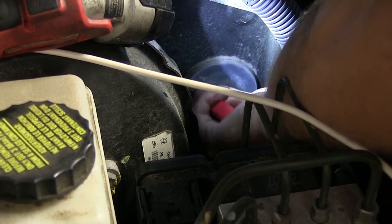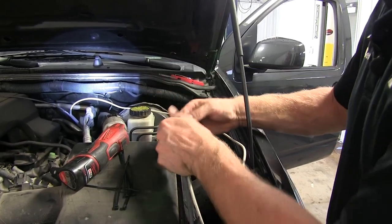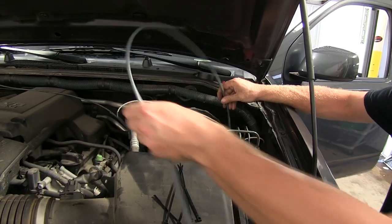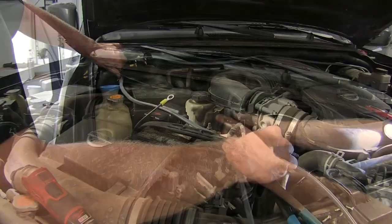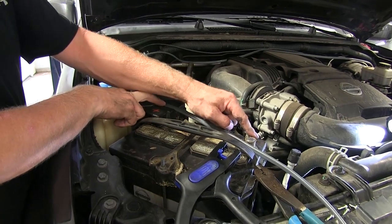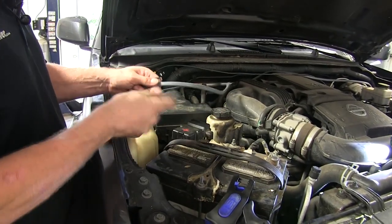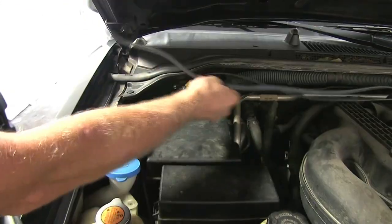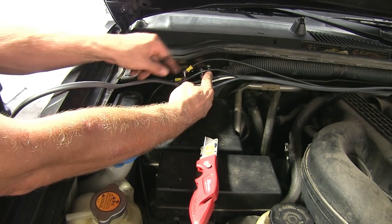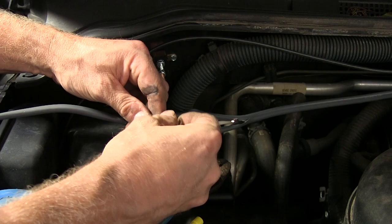Just make sure we stay away from the wires on the side. I'm going to bundle my three wires together temporarily with some electrical tape and push them on through. We'll go ahead and take our new cable here and follow the path of our original black cable, and see how much wire we need going through the circuit breakers and to our battery. We'll also need to accommodate going to our positive side of the battery and also our ground, or negative side of the battery. We'll cut off our excess, then take a few moments to separate our wires to give some working room, and separate a small section here to get access to our black wire.